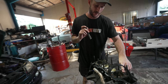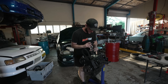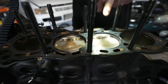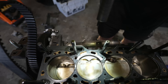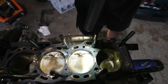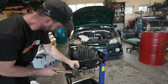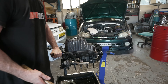This is a brand new head gasket — we only ran it just for that day. You can see all the black paint has come off. Cylinder number two has let go and pushed the coolant out of the gallery there. And in between the cylinders you can see it's taken the paint off. The tops of the pistons look pretty good still — no melting marks.